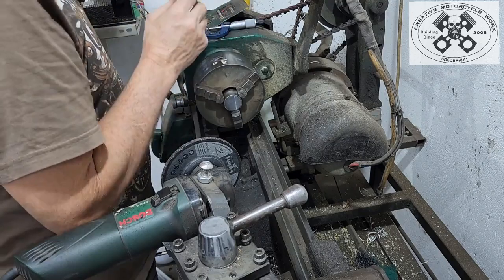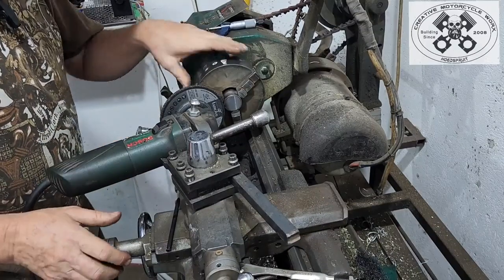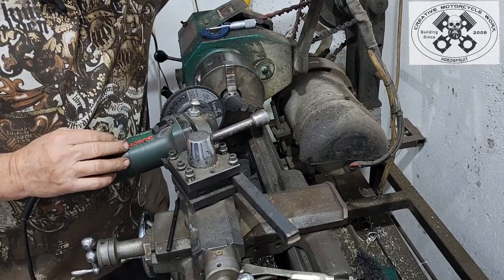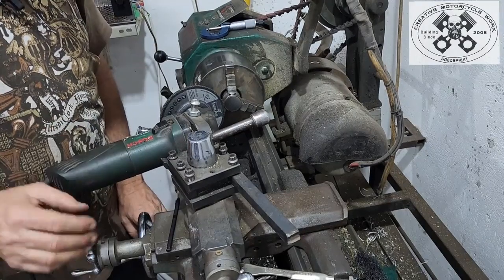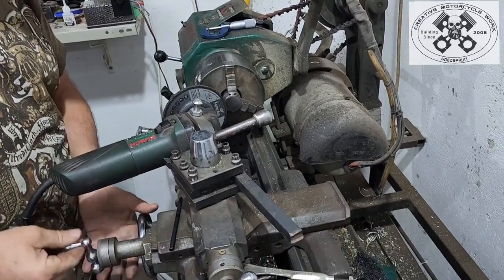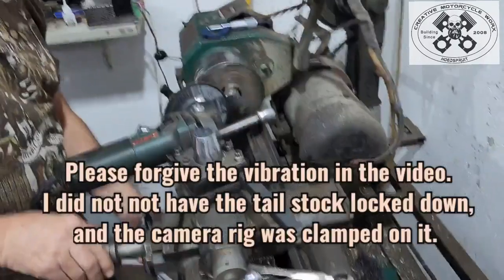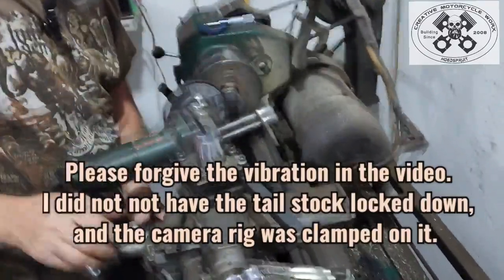Now what I do is bring my saddle up. I'm going to quickly take my cross slide over and run it until I see just the first few sparks coming out, or the grinding just moves slightly — so I can tell it's just touching.